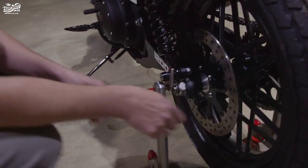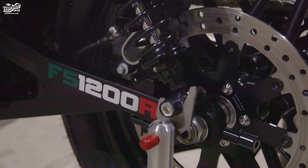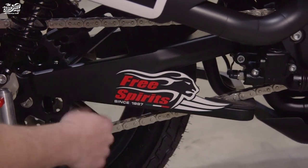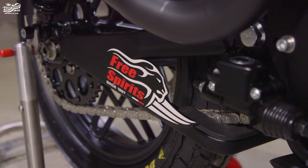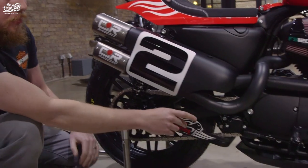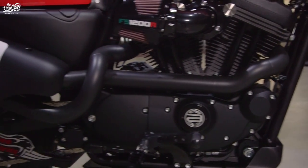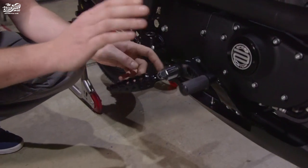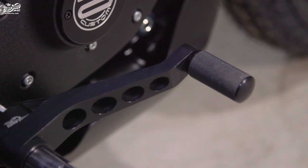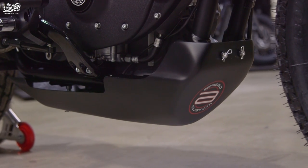Around this side we've got another Free Spirits disc with a standard caliper and a Free Spirits mount. The swing arm is a stock unit that's been modified with the fork brace and the Free Spirits logo has been cut out to accent that. These cans were made by John from Race Fit — they're one-off made for us. The header pipes were made in house, handmade from 2 inch stainless pipe. The number board is also handmade from one piece of sheet steel. We've got RSD Moto pegs with Free Spirits brake lever and gear lever the other side, and an XR 1200 belly pan that was also a Free Spirits unit.